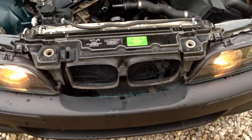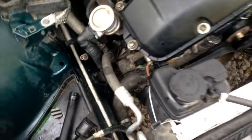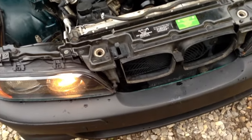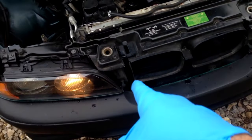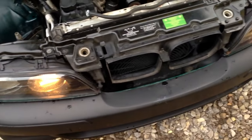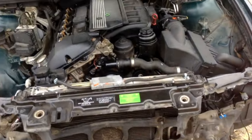Usually it's not the switch; we'll make sure the switch is plugged in good — it is. At this point we'll get our test box out, but a test box isn't strong enough. We'll have to use the battery charger and jumper to that little plug-in right there. If the fan comes on then it's good; if it does not then it needs a new fan.